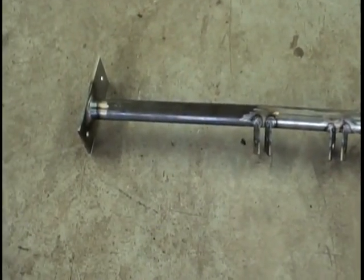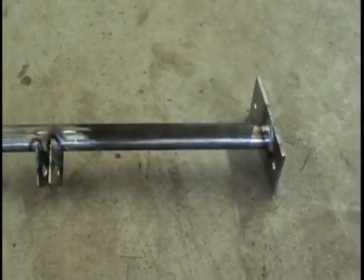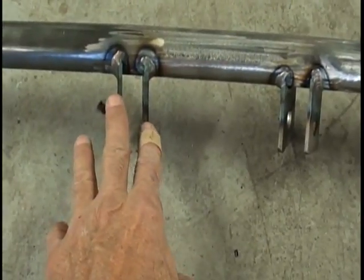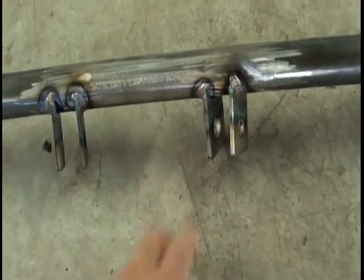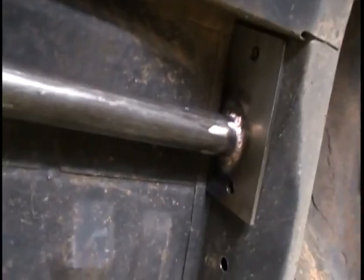Alright, next we're going to install our upper bar with the attachments for our trailing links that go to the top of our housing. This is our adjusting bars for setting our pinion angle. This is our 2 triangulated upper links. This bar is going to be installed next.